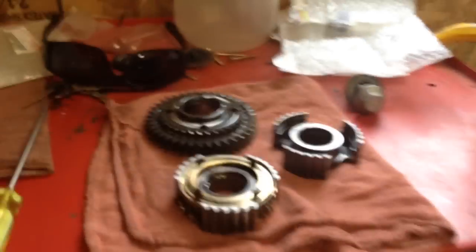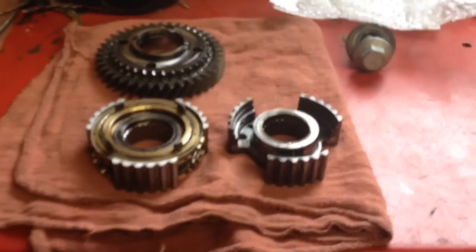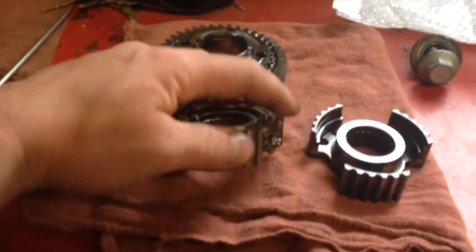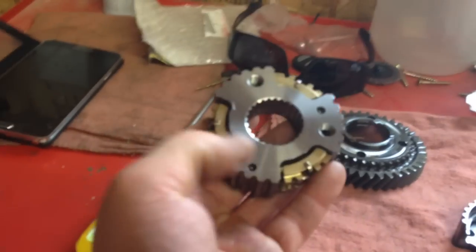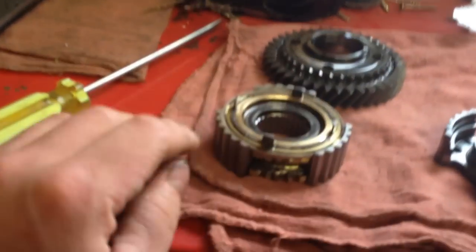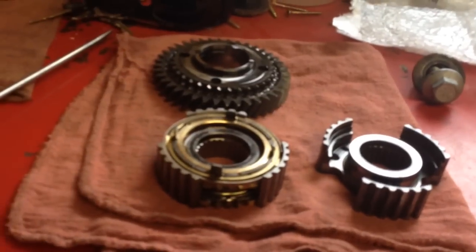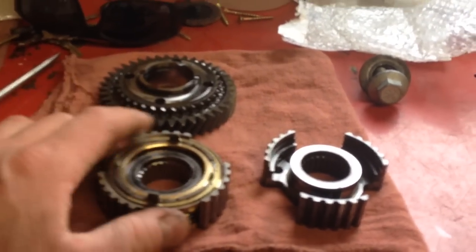Here's a tip for switching over the synchronizer cage — I wouldn't advise doing it, it's a complete total waste of parts. All the guts have to come out and they're all held in by clips. These little tabs have to line up in little holes, and attached to those tabs are springs. It all has to be lined up absolutely perfectly — you need about eight hands and a lot of patience. So don't even buy this cage.